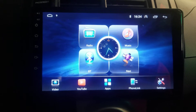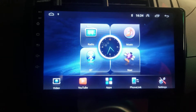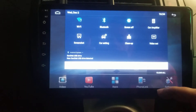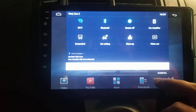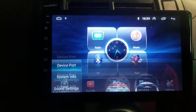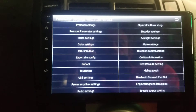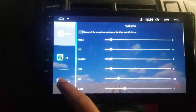Hello everyone. If you have been facing the problem that the USB is not detected by this Android panel after a reset, then this is the remedy. Go to Settings, Factory Settings, USB Settings, then go to Others.